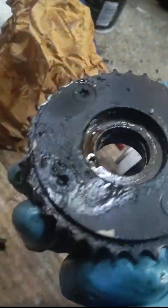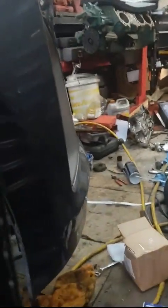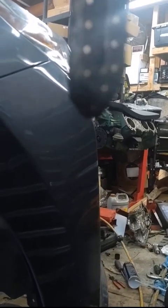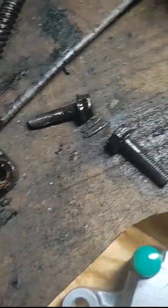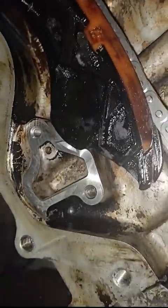Getting back to the timing chain - this is the bolt that holds the front gear. You can tell there's tons of sludge behind it. I had to take it apart - it was a snap ring. I just can't believe how filthy dirty it is no matter what you spray on the outside. But if you look carefully at the original chain versus the new one - you can see the yellow marks, the purple marks - it is definitely way more stretched. New versus destroyed.